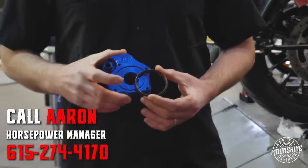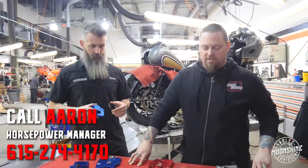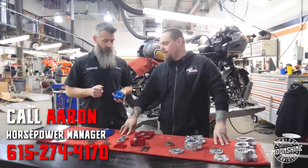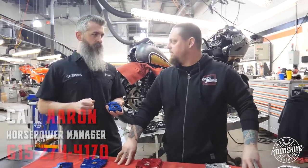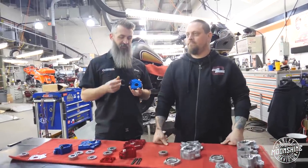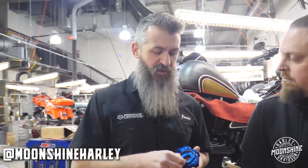It does take the OEM seal if you like it — it's not something that's necessary for the pump to function. But S&S has worked closely with Harley-Davidson for a lot of years, and Harley-Davidson does so many millions of dollars of R&D. If Harley feels like this is a good idea, then S&S put it as an option. Their pumps are currently all coming with the option to put this seal on. If you've already installed the S&S pump in your bike, it's not necessary to change — it might not have this. S&S believes it is better to have it. We haven't had any problems in any of the motors we installed the S&S pump in that did not come with the seal. This is a change in their design after the fact because it is mimicking what Harley's doing, but we have not had a single problem. All the ones we do from now on will have the seal though.